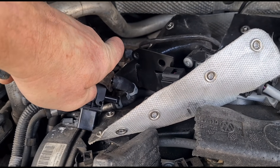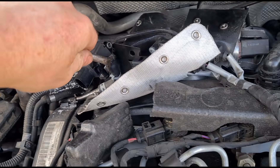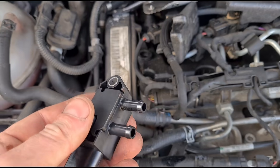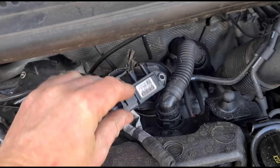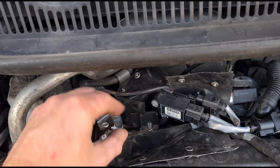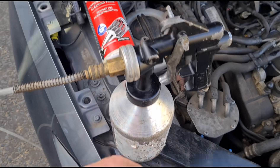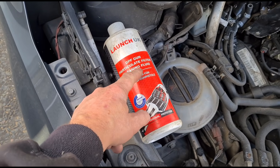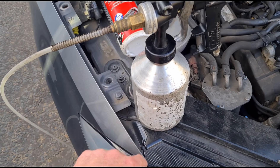If these things are being a bit stubborn I like to use this little trim tool here — it's brilliant. You just get it over the holes and you can see it's pushing it off nice and easy. Now we've got that sensor out of the way we'll reconnect it to the plug, because we can't just yank on it with the electrical cable on it. I've got this DPF cleaning gun here and the Launch UK DPF cleaning fluid — both from Launch. My Launch writing has worn off; it's probably seen about a thousand DPF cleans in the last year.